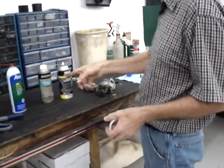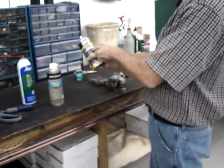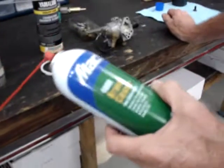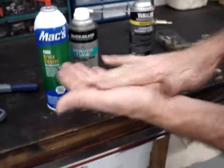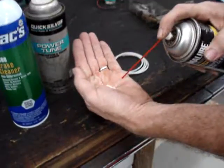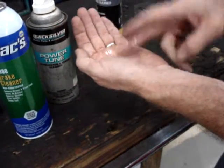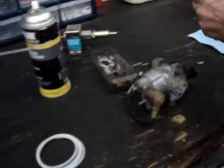Go to your Yamaha or Mercury dealer and get a can of Powertune or combustion chamber cleaner. Do not bother with brake cleaner or carburetor cleaner — neither one is very good. You'll see them cut, they clean your hands and feel cold, and you think they're doing a great job. This stuff, on the other hand, is very foamy when you spray it. When you put your hand in it, it doesn't feel as aggressive, but it will burn on a cut — which creates the illusion it's more aggressive as a solvent, but that's not actually the case.